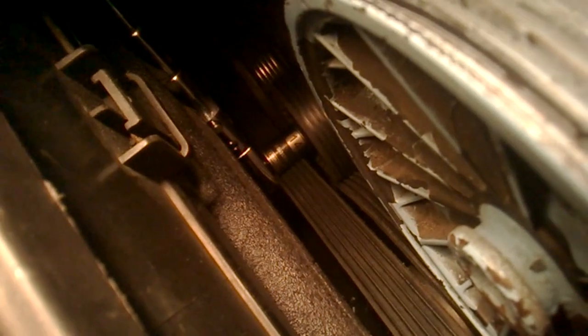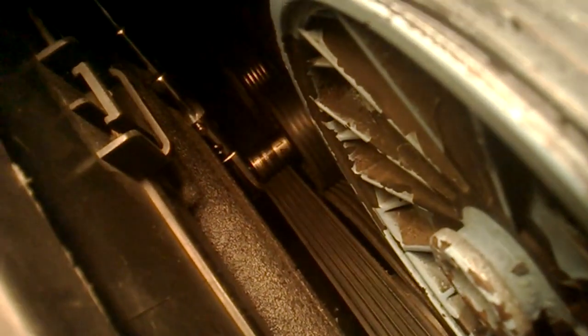You could push the bearing further in but make sure you get it right. I don't think it has to go to the bottom of the pulley — probably the face of the bearing on the compressor side just matches the face of the pulley. Now about to place the serpentine belt back. You can get the routing from Google images. I'm using an extendable ratchet which will absolutely save your day when removing or putting back the belt.